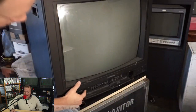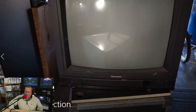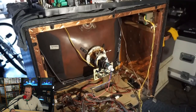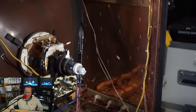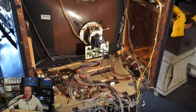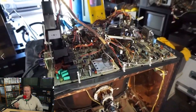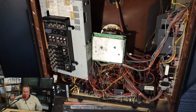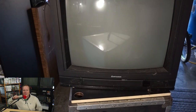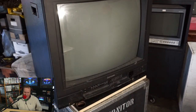Before firing it back up, I did want to show you briefly — going back inside the monitor — it's actually completely lined in high-quality copper, stapled onto the wood frame. That does seem to help out with limiting exposure to outside magnetic fields. It really does decrease the amount of magnetism affecting the inside of the back side of the tube, and thus it doesn't affect the picture quality.